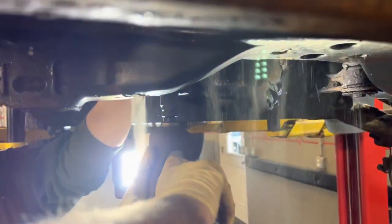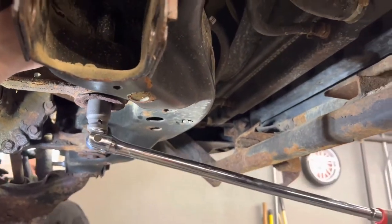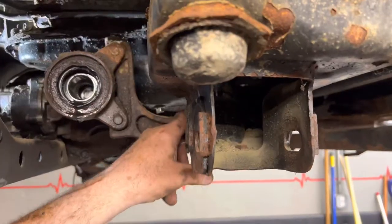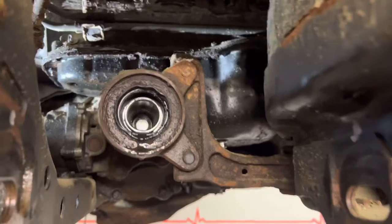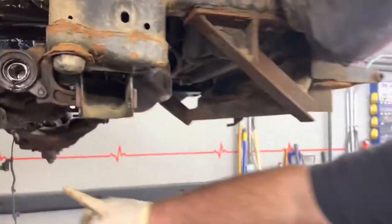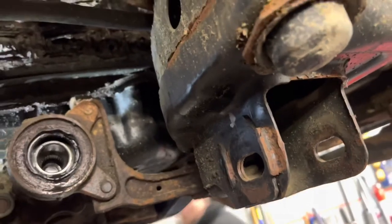To get out the pan, you've got to do the same procedure on the other side and take all that out. Brian's working on the other side. So what we're doing is we've got to remove the diff bracket - we've got the oil pan. It looks like there's two of them: one on one side and another one in the back, and a third one in the back that's an Allen head. We're taking the bolts out of all of these.